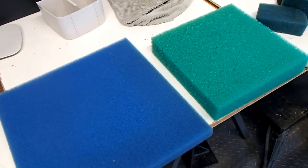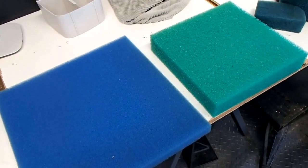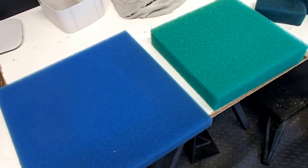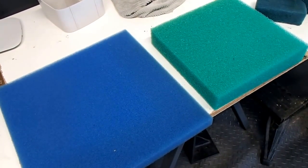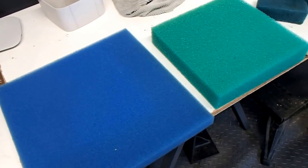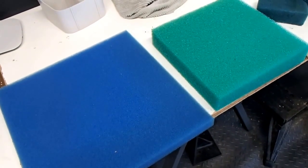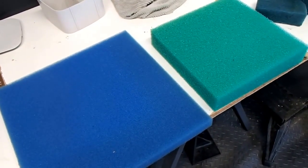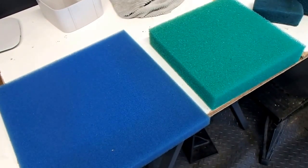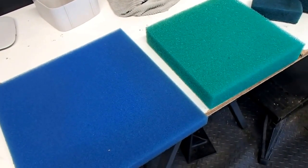The theory of the convoluted foam is that it provides more surface area, which is certainly true. And if that front surface did the main job of filtering, that would be a wonderful thing. But from my testing, it appeared to me that the debris was pretty well dispersed throughout the foam, and therefore all you really accomplish with the convolution is less volume and therefore less filtering volume. We will soon find out whether my theory is correct or not, if we get different enough results to tell.